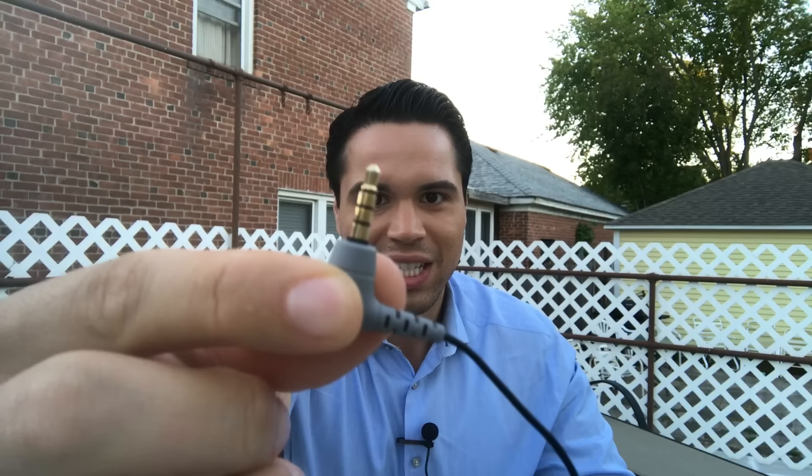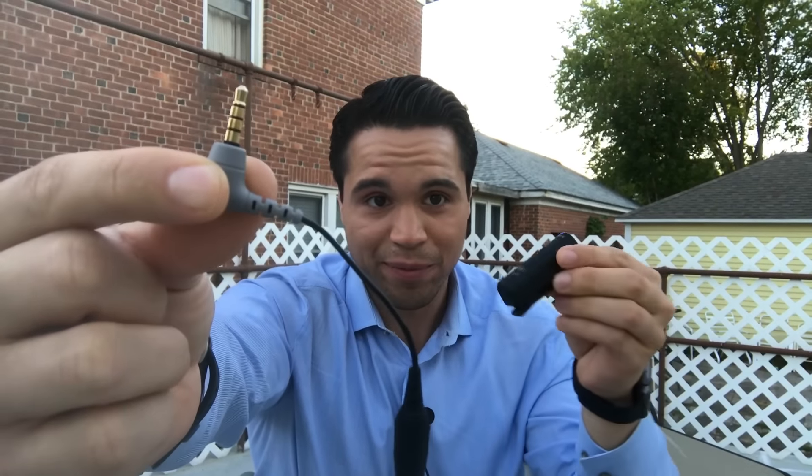Pairing these is fairly easy — you just have to power both on. The blue lights will blink, and once they're solid they're connected. I have my TRS to TRRS adapter right here and this is what's going to go into my phone. The receiver with the cord it comes with is going to be the output, then this goes into my TRRS adapter.